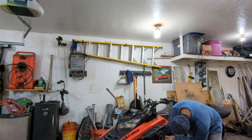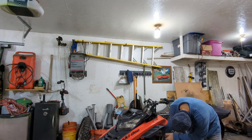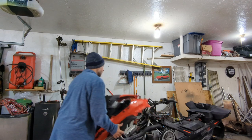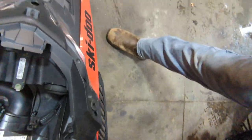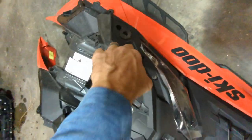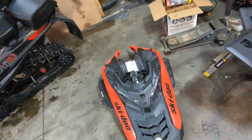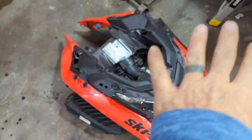There's the airbox clamp right here — figured it had to be on here somewhere. These airboxes, if it's anything like the 800, are a big pain to get lined back up when you put them back together. Once you have all the screws out, this thing comes off. Looks like I didn't need to try to get the headlight off separately because it comes off together with the hood. I took about six screws and a push pin I didn't have to.